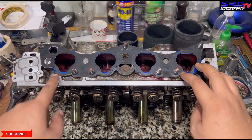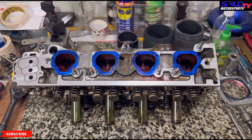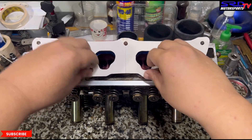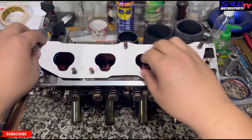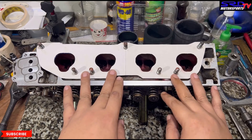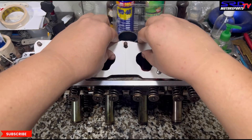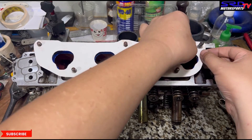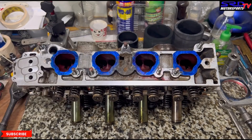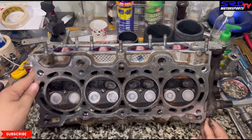You can see the OEM gasket is still off, and you could gasket match this — but that's a no-no. With the port match method you can match the intake manifold to be slightly smaller than the actual intake port, maybe 0.020 or 0.030 of an inch. This creates what's called an anti-reversion step, which is important for efficient running. At full throttle there is some reversion, and without that step things just go everywhere.